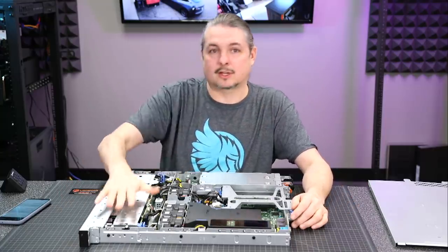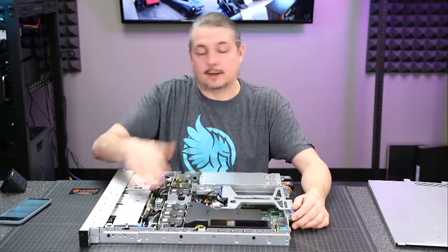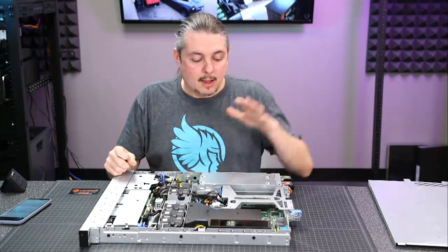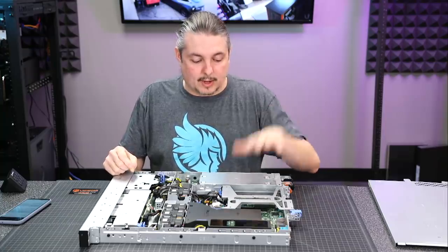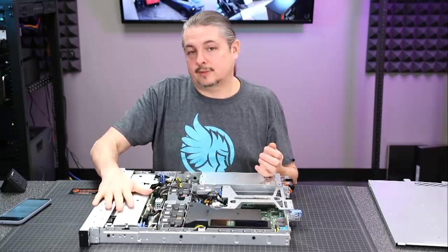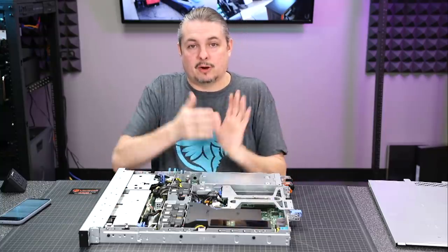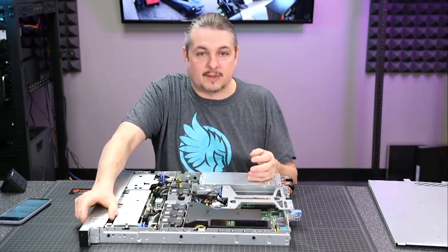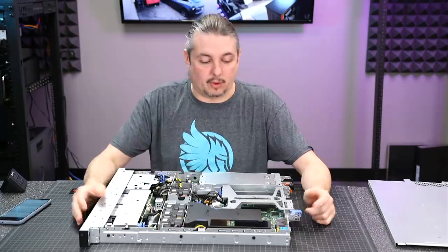Why didn't we load XCPNG on a USB and then use the drives 100% for storage? Well, if you have the RAID controller control the RAID - and yes, I'm aware XCPNG can handle RAID if you pass the drives through to it - but we set this up so the iDRAC will send out notifications if there's any problems with the RAID array. The RAID array is being handled so it presents as one large drive to XCPNG in a RAID 6 format, which gives us plenty of performance being that they're solid state. When we load XCPNG, it parses out the part it needs for the hypervisor, and the rest is dedicated to VM storage, leaving us about 6 terabytes of usable.